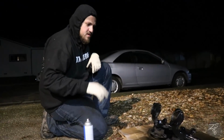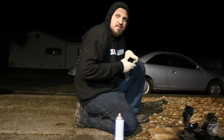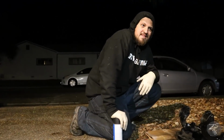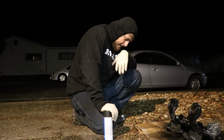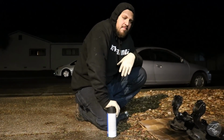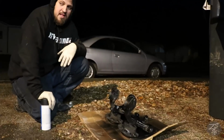Looks like he's done. Pretty much. You gotta cover the other side. How much more angle do you think? It's the same as what I have, but I don't know exactly how much angle I have though. I know it's over 70. It's probably the most 72 right now with these arms. But once I start fabricating, extending the control arms, I will get the whole angle. Because right now it bumps on the sway bar link with the caliper, but that's about it. Still is hella angle.